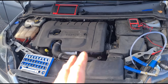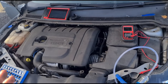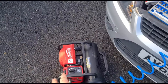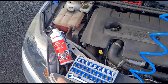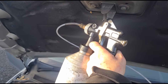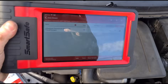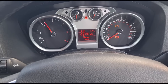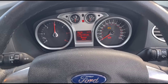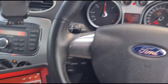I've shown you this process many times, but we're going to put some DPF cleaner through it. Compressor at 130 psi, using Launch UK DPF cleaning fluid — connect it up to the sensor port and blast it in, squeeze the trigger. With everything put back together, we've got a reading of 6.9. Holding the revs at around 3000 rpm for about two minutes to see if we can get the pressure down further — 6.9 is a good range.